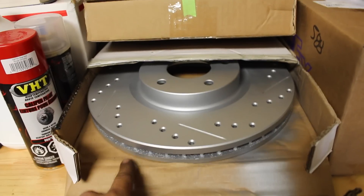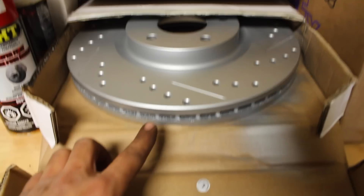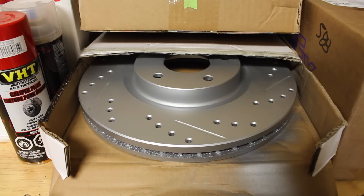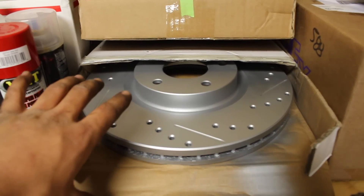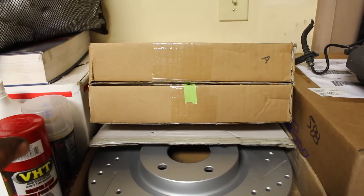Taking a look at the new brakes — we've got the front ones here and the rear ones here. I went with the same kind of brakes front and back, so these are not only ventilated but cross-drilled and slotted. You can go with whichever style rotor you prefer, but this is the one I went with. Because I'm doing the front brakes I figured why not replace the rears as well — however the rears are gonna be the same stock size as the original ones. I'll have links and information for everything in the description.